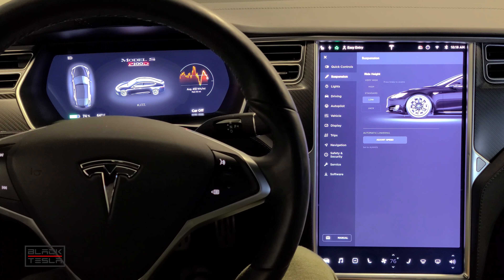If you have two Teslas, you want to alternate — one car sitting at 75% unplugged, the other at 75% plugged in — and maybe alternate day to day depending on how long you're sheltering in place. The next tip: if you have air suspension, make sure your suspension is set to standard, as opposed to high or low. I currently have it in low, but I'm going to turn the car on and change it to standard. This keeps your air compressors at a set level so your air suspension doesn't risk faulting or breaking from being held low or high too long.